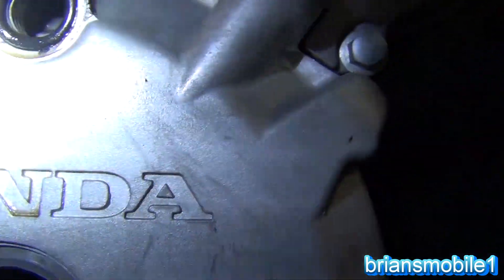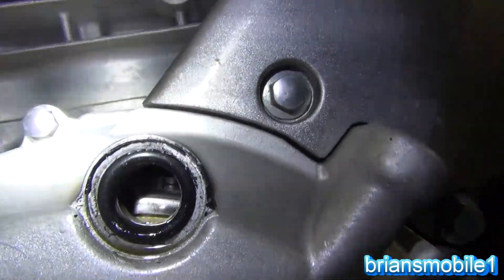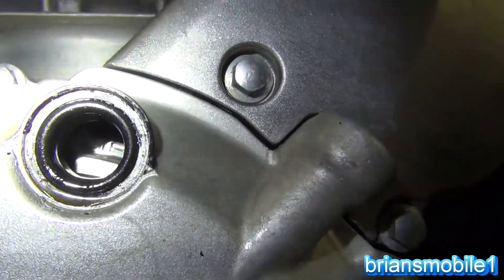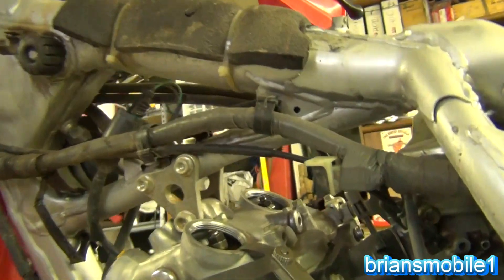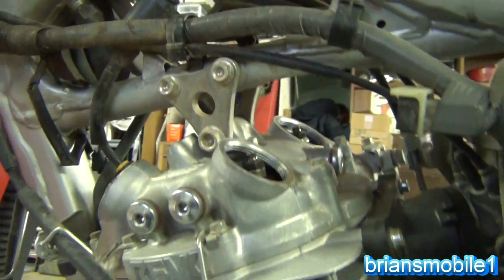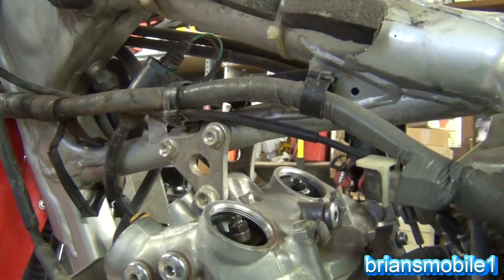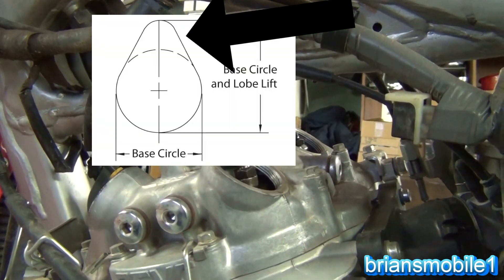Using a flashlight, you can see there's a line in the top and a little T in the bar. You'll see a line go by as you rotate it counterclockwise, then another line, then an F, then a line and a T. The one next to the T is where you put it for top dead center. You'll be turning it by the 14mm bolt. What you want is to get it to where both rockers can wiggle up and down with no tension — the gap will be consistent when the lobe is not on the camshaft.